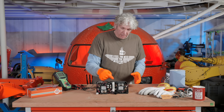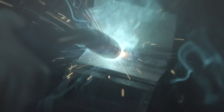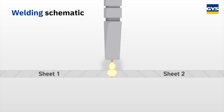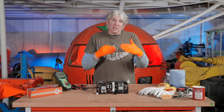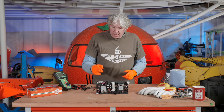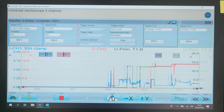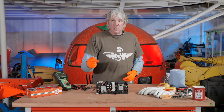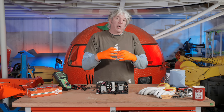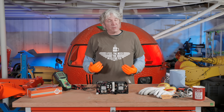Even though you've got that protection, sometimes the contactors can actually get stuck and weld together — just like welding metal of any kind using electric arcs. The electric arc is so hot, there's so much current that it actually melts the steel. That either causes a weld or blows a hole, depending on how well it's going. That welding welds those contactors together, and that's why the car does a little dance at the beginning. By turning on the positive contactor and seeing if it detects voltage, it can tell whether the negative contactor is welded shut — quite a clever self-protection system.